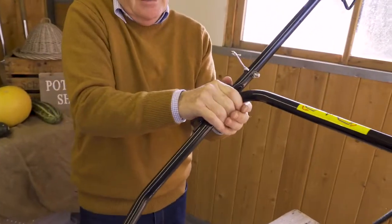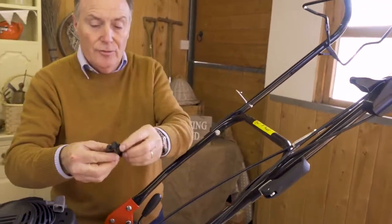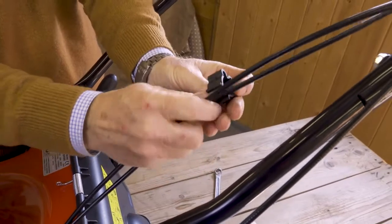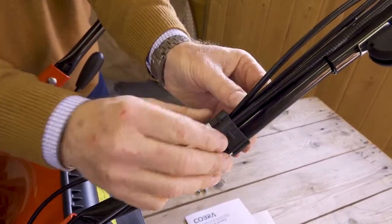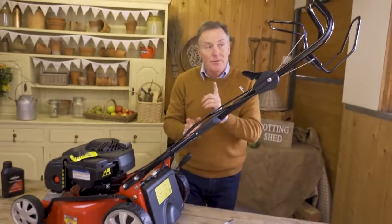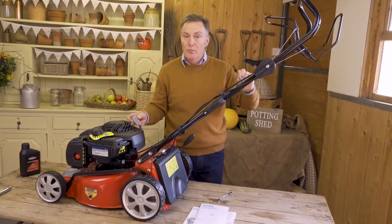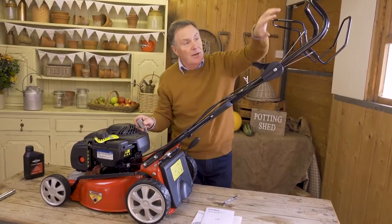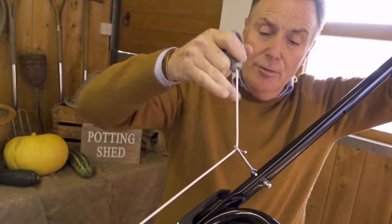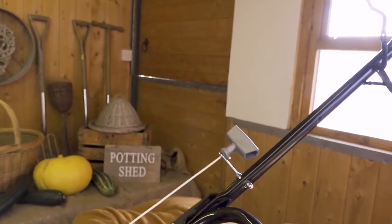Finally, make sure all cables are held together. It's supplied with a clip that holds three cables — put the cables in first and then pop the clip on. The mower has a recoil start and there's a small bracket that holds the cord so you don't have to bend down when starting. Pull in the front lever to take compression off the engine, then gently pull the cord out and loop it around the bracket so it's ready for starting.